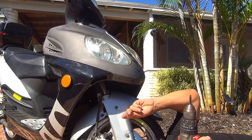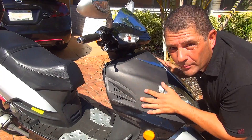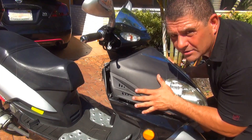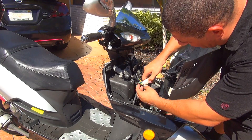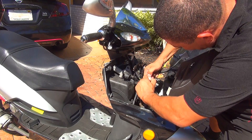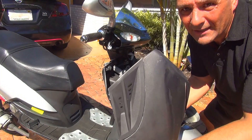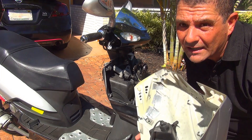Those are the 2 screws in front of your scooter. At this point the nose is free. To remove the front part, put one hand on each side and start to slightly wiggle the front part. You will see the connection for your lights — push the connection and get it apart. Remove this front piece carefully because everything is made of plastic and these parts can be hard to find, so removing the lights gives you more room to work.